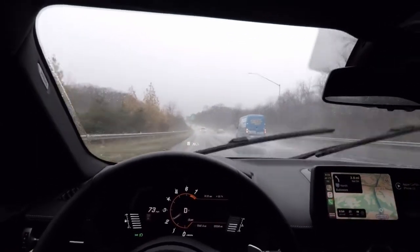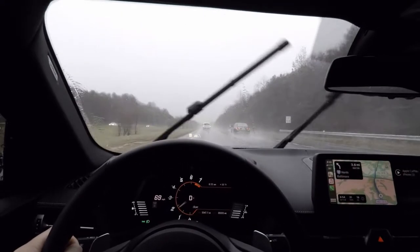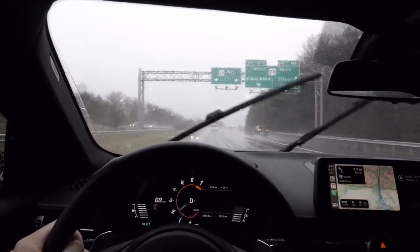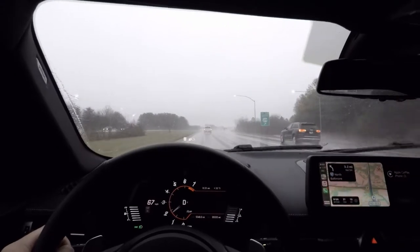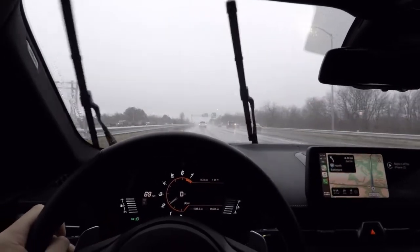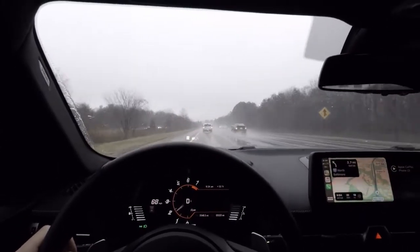I've been doing about 65 to 75 miles an hour and been totally fine with these tires. I know a lot of people are using the t-bolt clamps — if you've used them or are using them now, drop a comment and let me know how you like them. I think that's probably what I'll have to switch to instead of these AMS clamps, because I was driving on the highway, pushing the car, and all of a sudden I just heard a boom under the hood. Looks like it was just the charge pipe that came off — I'm not sure those clamps can really hold. So I'm thinking about switching to the t-bolt.